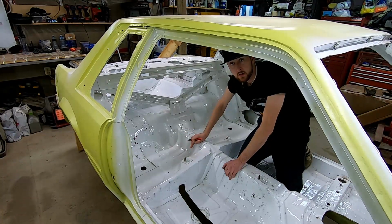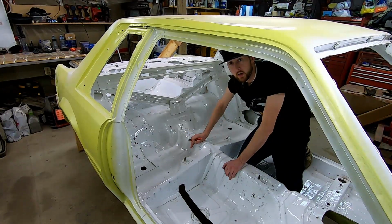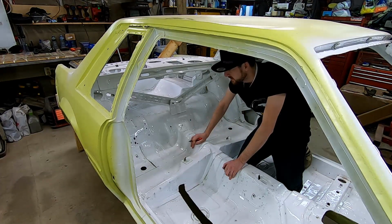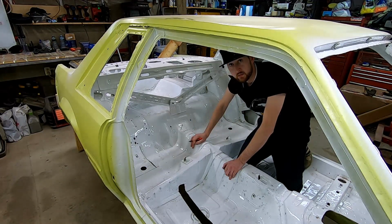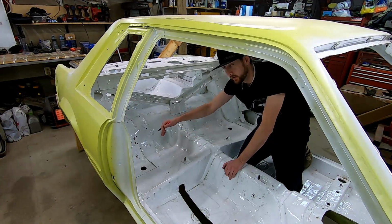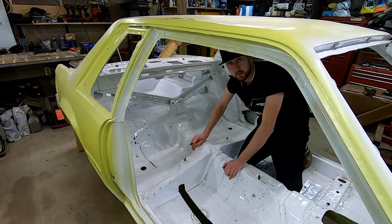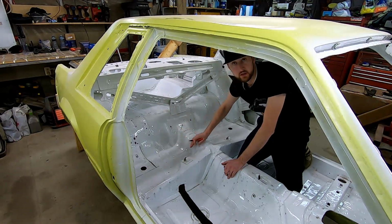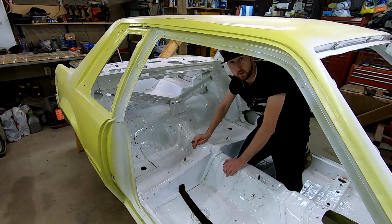The bottom side, I may actually go under and do a small pilot hole through the spot welds on any items that we're not too worried about keeping, and then I actually have an alignment hole to start drilling the spot weld out from the top. So just another option. We'll get a light over this, see as much as we can, and then go to that option.